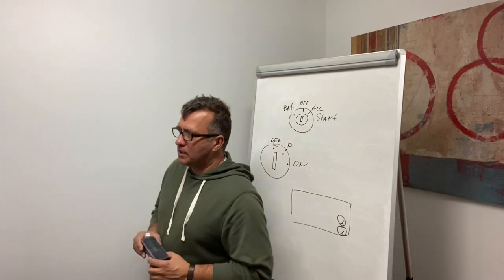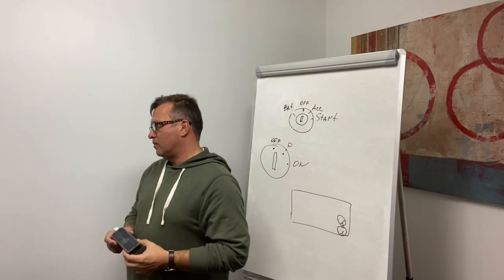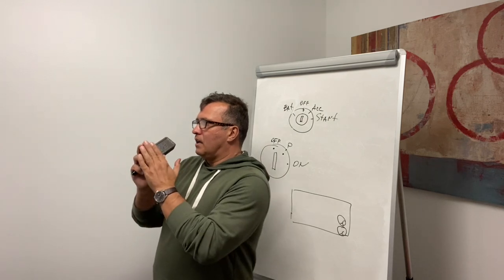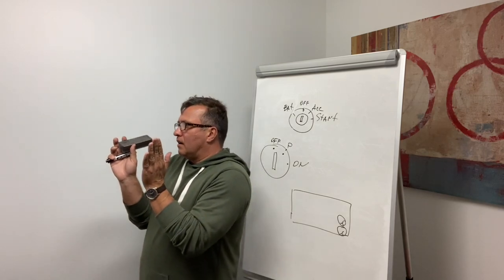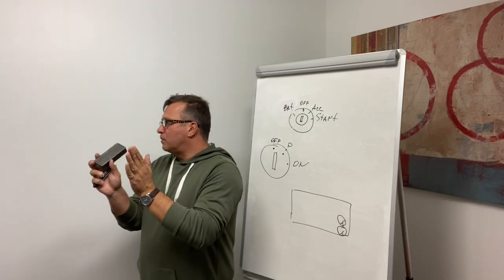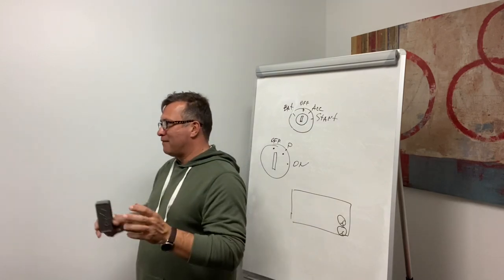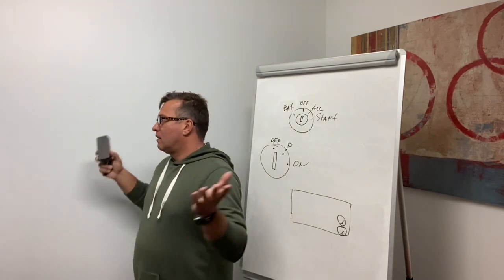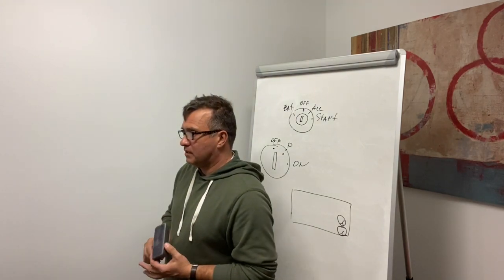And it's very important, especially today when we will be doing brakes, to say exactly what it is in the handbook. Okay? In some cases, for example, my emergency brake system, the yellow and red button should pop out between 20 and 45. Between 20 and 45. You cannot say 25, 45. You cannot say 25, 40. Even if you say 45 to 20, it's going to fail your test because we cannot make any mistakes on brakes.